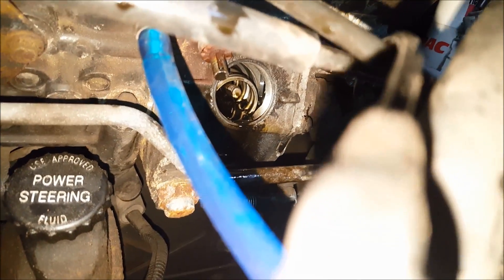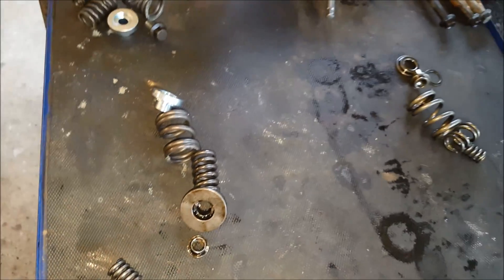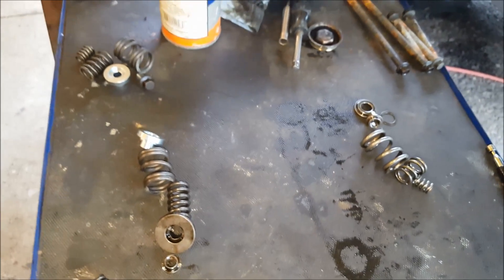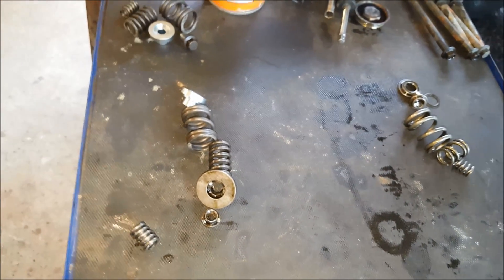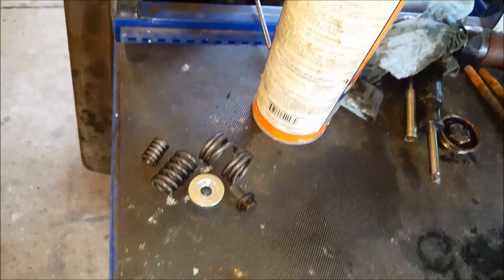When you're taking those out, make sure you don't lose any of those shims because you don't want them going into the bottom of the pump. Then you're going to rotate the engine until the other spring set is exposed and do the same thing with the other set. Otherwise, putting this thing back together is pretty basic — just install the two springs, tighten it back down, and secure everything where it needs to be.